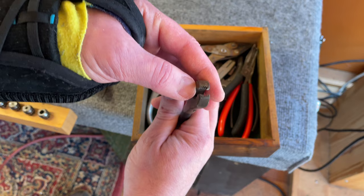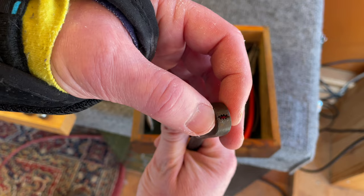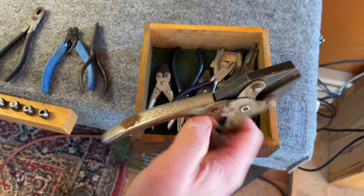This is another set of Utica pliers, actually pretty useful. These are like gas pipe fitting lineman's pliers for gas ranges back in the day, and they're really helpful for extracting really stuck rods — you can grab it on the end and pull. Obviously it's going to kind of ruin the rod, but when they're that stuck, you usually want to replace anyway.